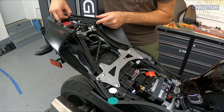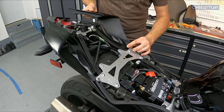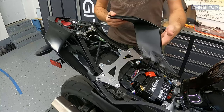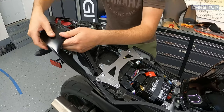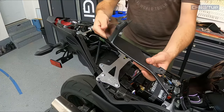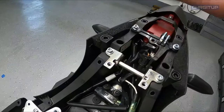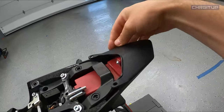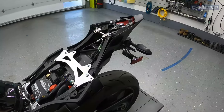I'm going to go ahead and lift up and pull outwards. On this side right here, you're going to slowly pull it up from this section. And there you go — there is the left side rear fender flare. Same thing on this side: lift up the back plastic to release the little tab, pull out, and then you can pull out this guy from its place as well. That's the right side fender flare. Now it gives us access to the sides, and at this point you could even go further by removing the entire back plastic piece that holds this entire area on — that's one big piece that comes off, but that's for a different video.